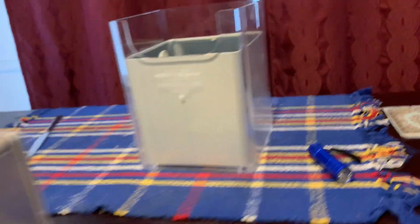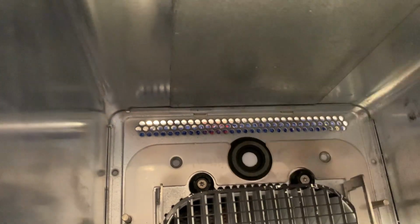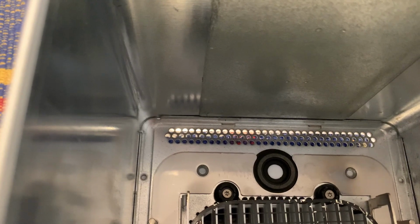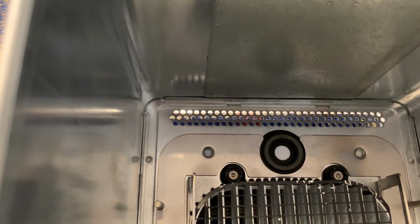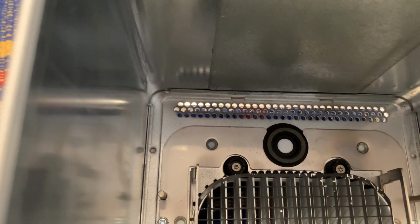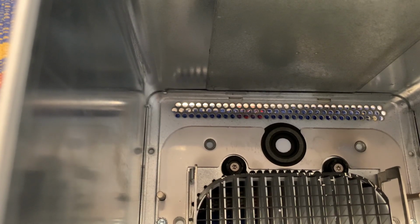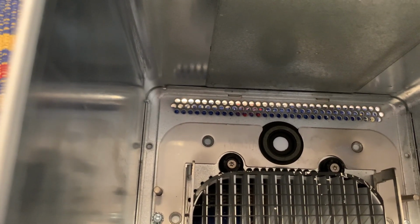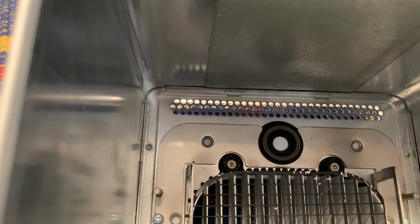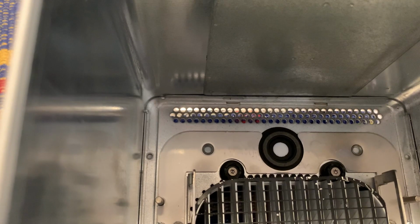All right, now, one other thing you need to look at. In terms of the problem starting and stopping, on the enclosure, this here is the bottom side of where the power button is, such as the power button is. There is a rubber gasket in there. Now, the way to fix the problem really would be to replace the gasket. You just can't get replacement gaskets anymore. So there's a couple of possibilities. One would be to buy a big set of rubber gaskets in hopes that there would be one in there that would actually fit. The other is to put electrical tape.